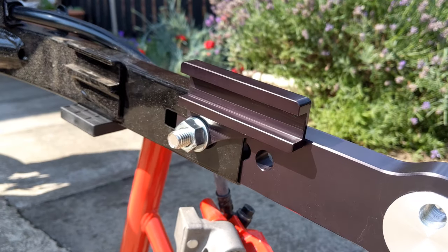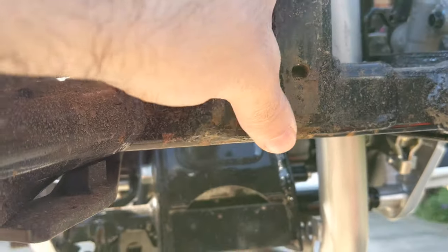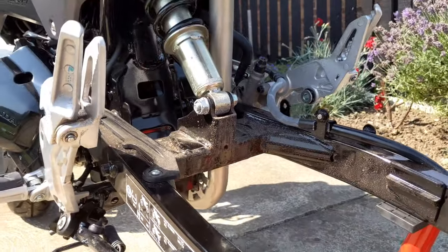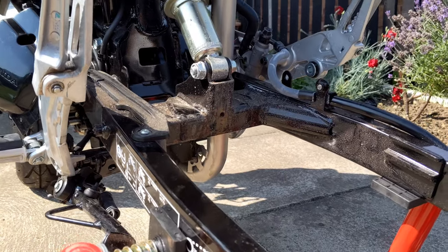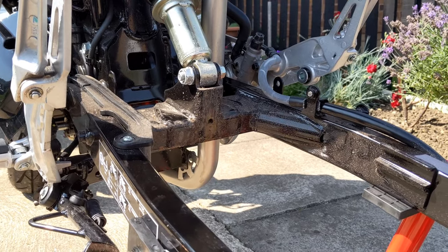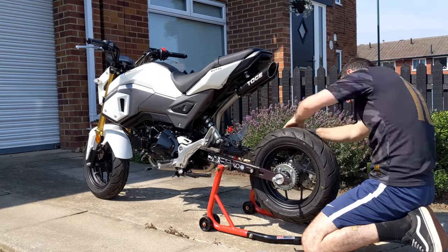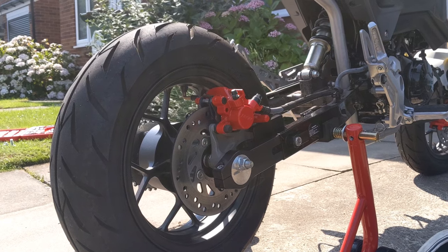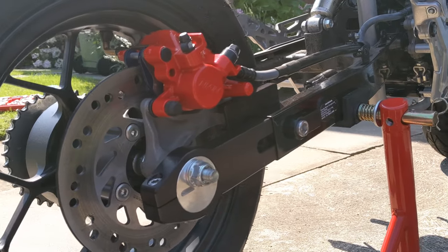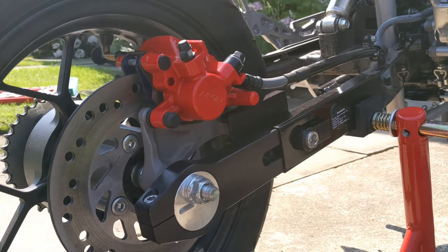Your little washer goes in between that and the box section of the swing arm. Nut and washer on the other side, and it's pretty much the same over there as well, except you also have to put the brake caliper slider on there. I spotted a little bit of rust on the underside of where I'm going to fit the lower end link, but all that muck was hidden under the rear hugger when I washed the bike so I couldn't have noticed it. Anyway, I had to crack on and fit the back wheel — just a case of refitting it. You might have to prise the pistons back open on your caliper if you knocked it, but mine were alright. I hadn't bothered refitting the new chain just yet, and I had to go to work, so I rolled it back into the garage and picked it up a few days later when the thunderstorms had passed.